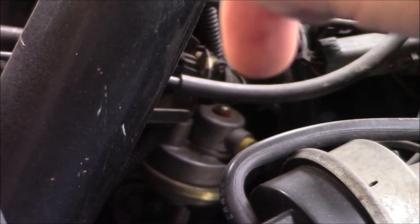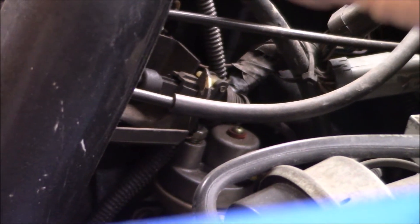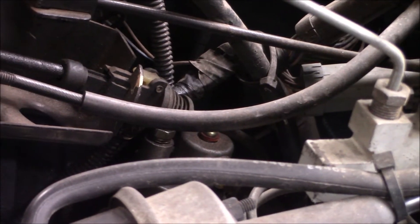I'll need to scrape the gasket without getting anything into the crankcase, and I'm also going to have to cut a little bit of the insulation in the area above the pump to make room for the new fuel line.